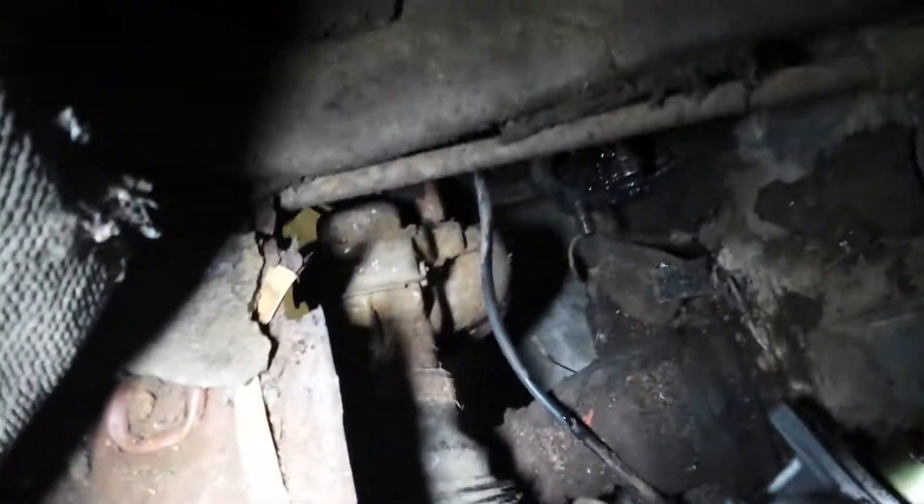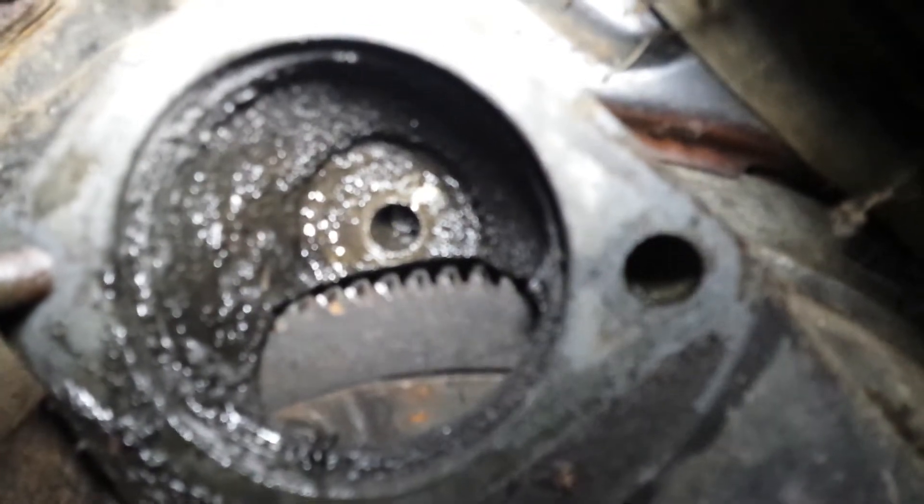Having a starter problem. Read a lot of forums online that said your starter's not cranking over real fast — could be because of this bushing right here. Luckily the back of mine is pretty rusted out so I can just replace my starter from the top; I think you normally have to do it from the bottom. The bushing in there, when it gets worn out, your starter's not able to stay centered while it's turning over and it rubs on the side walls inside the starter and kind of makes a ruck-ruck sound — like a dog whining. That's what it said online.